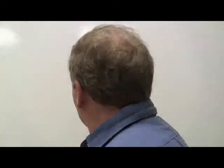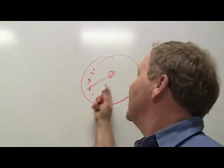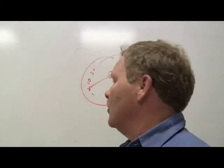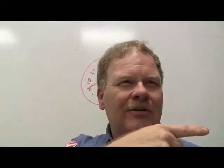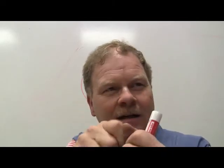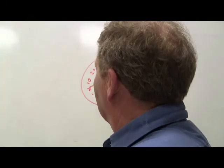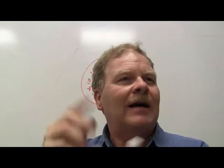All right. I noticed there was a mark right here. They had really no reason to be there, except I found out that, to get that needle off that shaft, I have a little screwdriver tool that I had made for something else. It was forked, kind of like our trim tool, but smaller. I bent it a little bit and made a little notch in the end of it. I'd put a rag on this instrument, put it under that thing, and pry a little bit, and that needle would pop off of that shaft. Just pop off, and I'd have it in my hand.